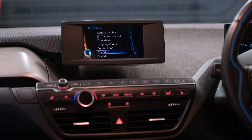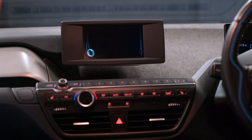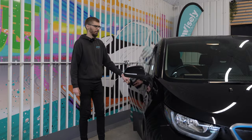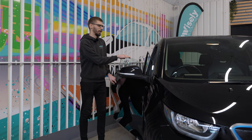So you can help yourself by lowering the window. To do that, comfort entry has to be selected in the doors and key section of the vehicle settings in the iDrive infotainment system. And once that's done, you can at any time double press the unlock button on the key. If you then open one of the front doors, the window rolls down halfway automatically.